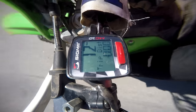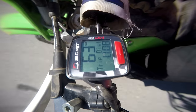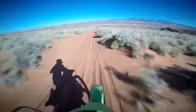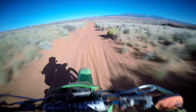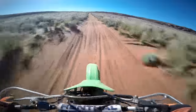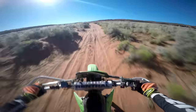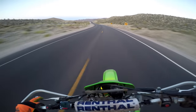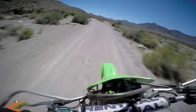The average 0-60 mph time recorded on my KDX at 3,000 feet elevation with a fresh engine was 6.2 seconds, which means it traded blows with my lightly modified CRF250X. However, as the engine wore more during the torture test, it became significantly faster, to the point that it would easily smoke my CRF250X. The top speed recorded was 81 mph with the gearing I use out here, which is one tooth up on the countershaft. That feels like it's limited simply by the power tapering off quickly at high RPM, but 81 mph is a pretty high speed for this style of bike.